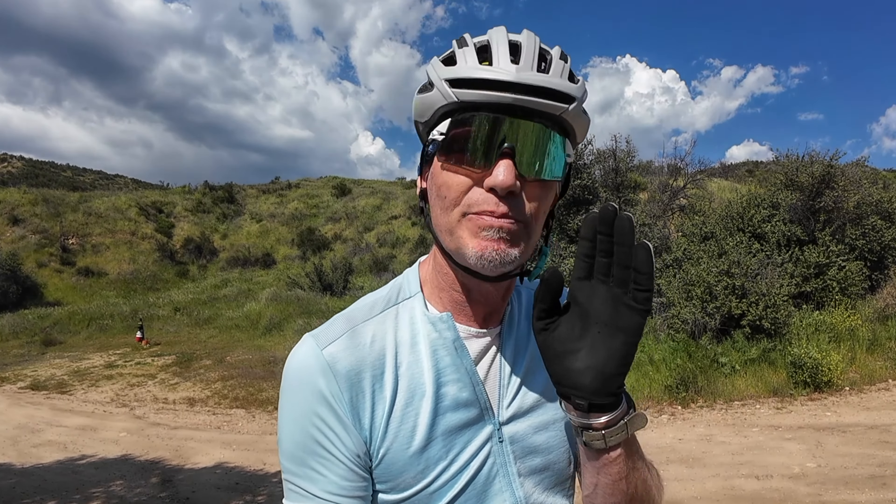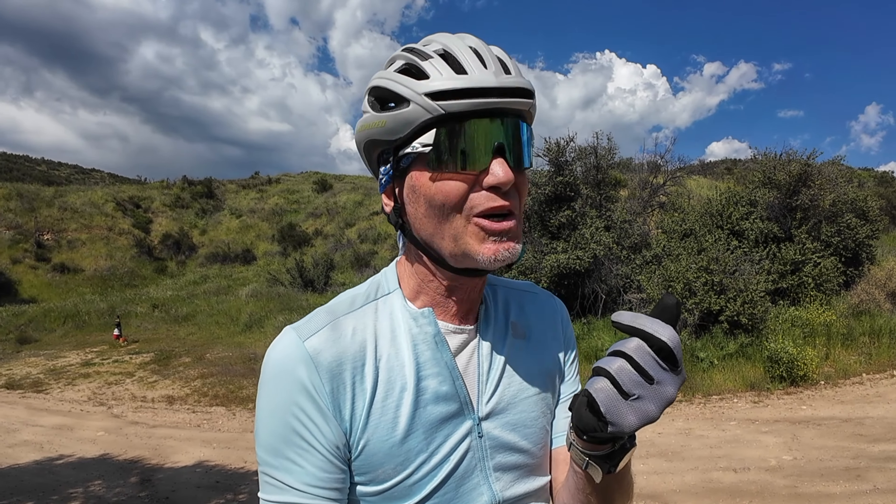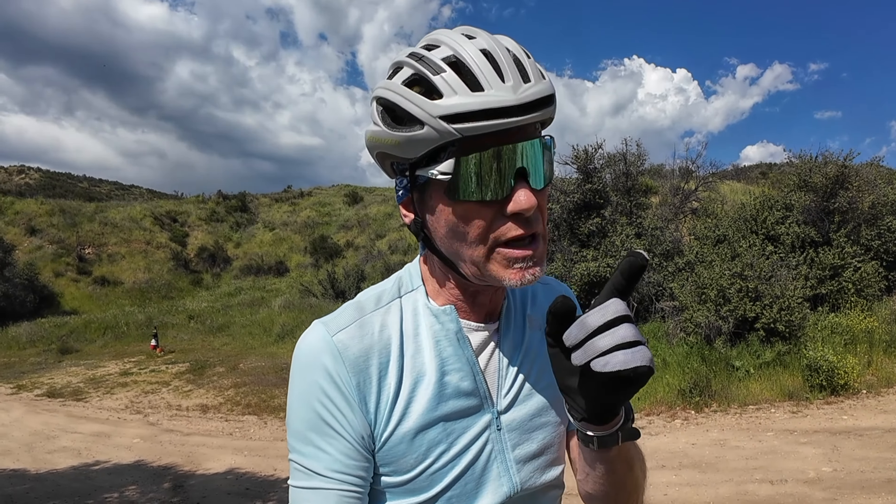Did I notice a great difference between the two posts when I rode them? Not really. The most noticeable difference was that the standard post with 35 millimeters of travel felt like it had a wider sweet spot in which to operate. I left the springs as they came out of the box but put in about a turn and a half of spring preload, which actually worked out quite well. Once I got it set so it wasn't too soft or saggy, overall it felt smoother throughout the day on bumpy rides.